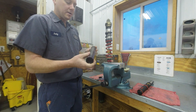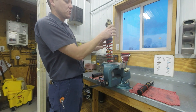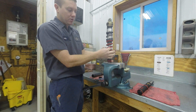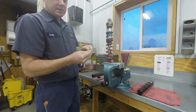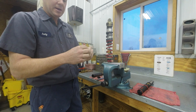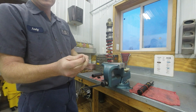We like to get things out quickly, so usually we'll cut these bodies and re-thread them. With Elka shocks, the bodies actually unscrew out of the top. The tricky part is they're loctited in, and you have to hold the chrome shaft without ruining it — we have special clamps in-house for that. Also, rebound-adjustable shafts have a metering rod; these shafts are hollow and you have to set that metering rod just right, or you won't have any adjustment. Peps have a nut on top and you adjust that nut to get the right travel on each shock.